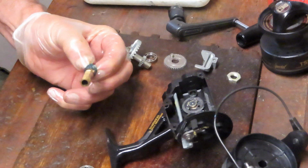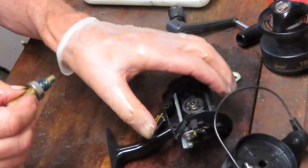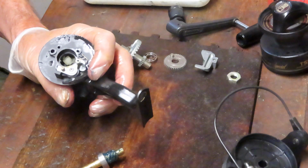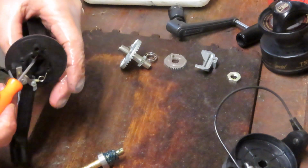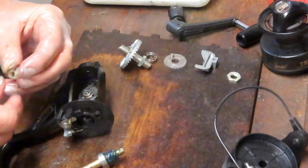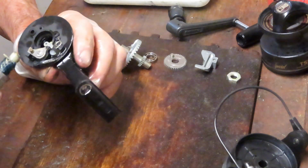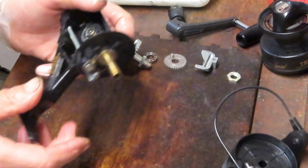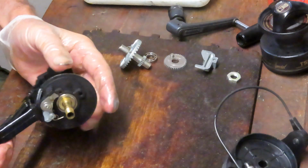Next up, we noticed as we go to reassemble that this was the downside of the bearing. And then we have that shim washer that we were talking about in terms of making sure that's on there. I have a little washer underneath here that we need to make sure is fitting right for the axle shaft. There we go. I'm trying to get it out there. That belongs as a sleeve on here. And when you go to install, there's a flat side in the back here, and that's where that rests. So when you go to put that in, that's the proper install. You won't see the plastic piece which is resting against the case in the back. So that's the way that installs.